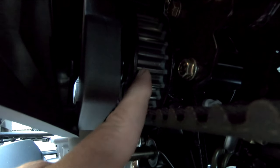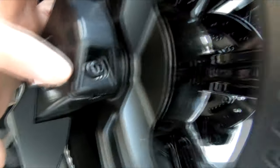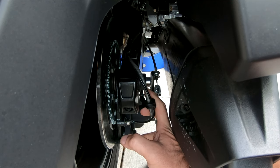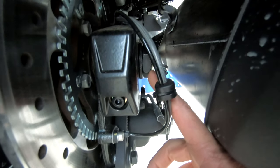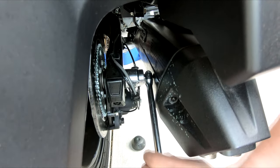We're going to go ahead and adjust this belt. Basically you have a nut on each side that needs to be loosened for the rear axle, and then these are your adjustment screws — allen head screws — to adjust the belt. On the right side, there's the nut we're going to loosen. This is a 36 millimeter nut. I don't have a 36 millimeter wrench to get in here, all I have is a socket — it's tight but it's doable.